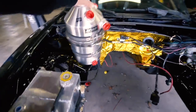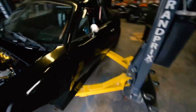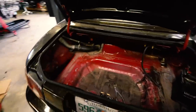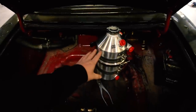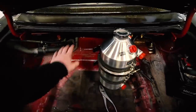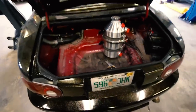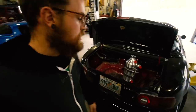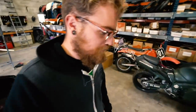I'm thinking engine bay is out of the question, unless we replace the engine with it. The thought about behind the seats, like mounted to the roll bar - but obviously you don't want hot oil in the passenger compartment and it would be hard to get to the fill. I think I've kind of settled on in the trunk, which it's just barely too tall for. Basically mount this here except obviously it's a shorter version of it, then build like a plate to mount it and mount the breather here. We should only have two lines that we have to run all the way up to the front. So it really won't be that bad - that was one of my concerns was plumbing. But once I started looking at how everything goes together, it's only two lines to the tank, which really isn't bad at all. It would be ideal to have it in the engine bay, but unfortunately we're not in a position to do that in such a small car with such a big engine.